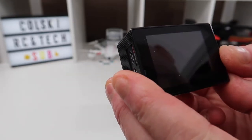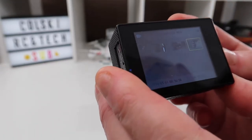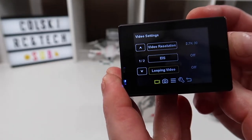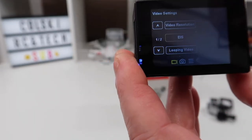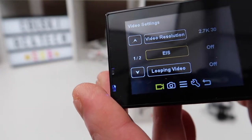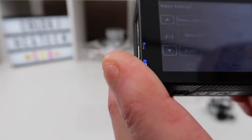If you press the front button it takes you into modes. Here's your video resolution — you adjust it by going up and down with the side buttons, then click the top button and it'll save it. It has EIS — electronic image stabilisation — but I do not recommend using it as it makes your picture very soft. You might want to use it if you have the video looping. You can also do time-lapse, slow-mo, and audio recordings.